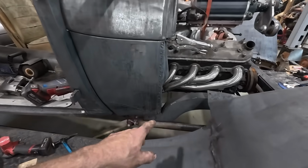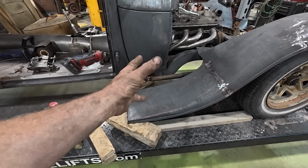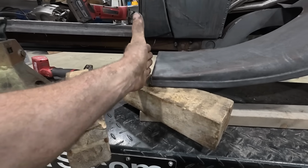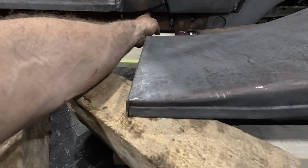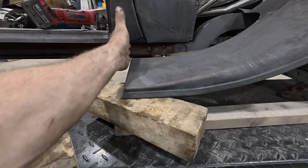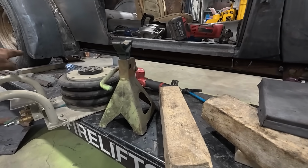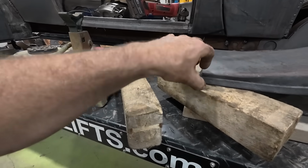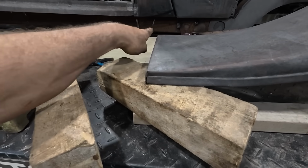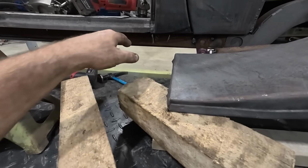We have our trailing arm just tacked in. So now in my head, in the big picture, what I'm going to have is room here that I'll be able to maybe take some quarter inch plate or something. I can go here and we can make a bracket off the chassis that this fender can bolt to, so it'll have a rigid structure. And then from there, we'll figure out the rest of it. Like this one, we'll probably be able to just make with some regular sheet metal, kind of go over, and then with a little bit of a flare, maybe underneath it. Maybe it'll go underneath. I don't know how we're going to do that yet.